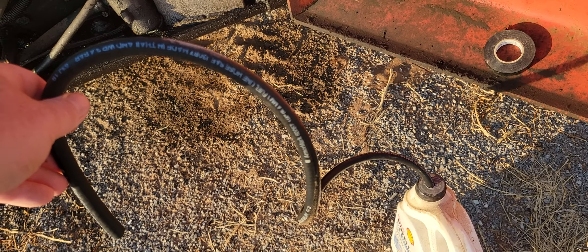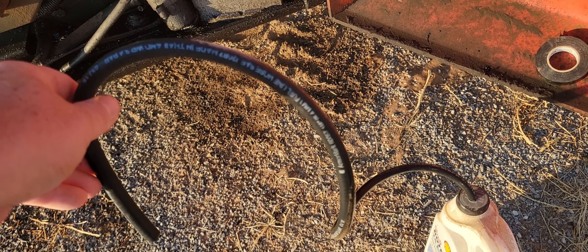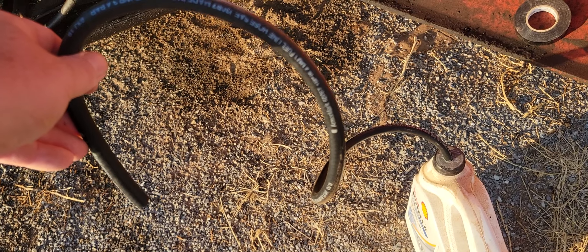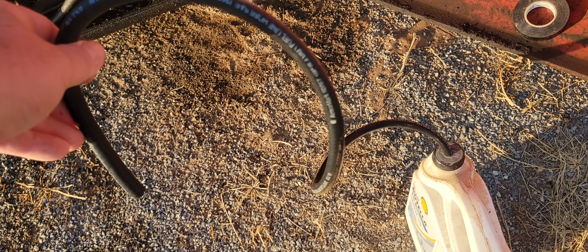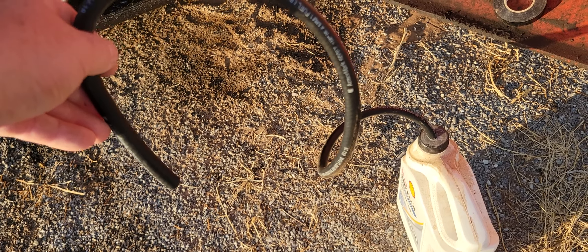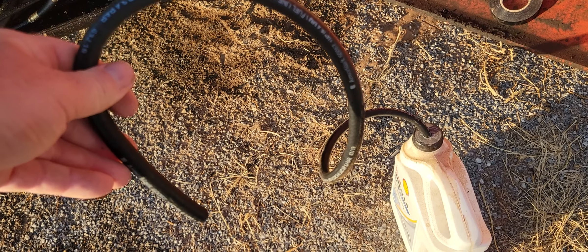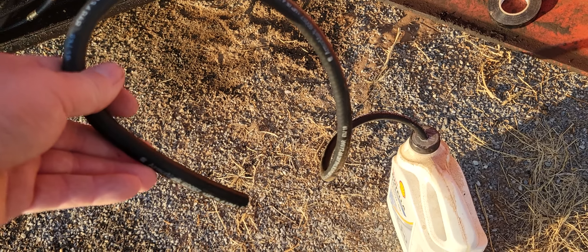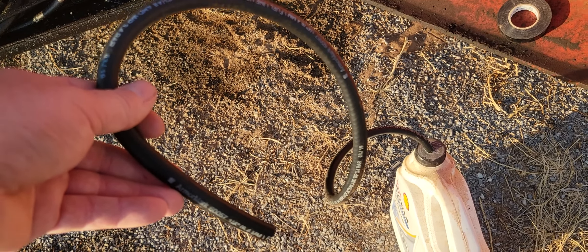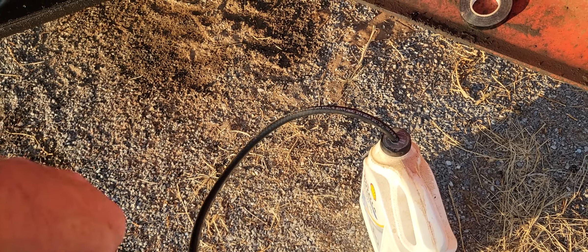It's a very small amount of oil that comes out, but it needs a vent to let the pressure escape. This will give it that vent, but it will also keep that oil from getting all over everything and catch the oil that does come through so I can just dump it right back in. Not the perfect solution — this is pretty redneck and it could be risky using a motor that's that wore out — but I've got to rebuild it anyhow and I really need it bad right now. We're just going to replace the dipstick with hose and let that oil blow right back into the bucket. I'm a little sketchy of a redneck, but it's going to work — I know it will, I've tried it before.